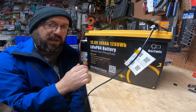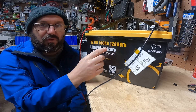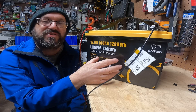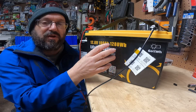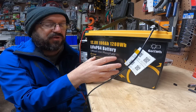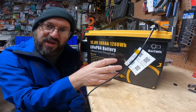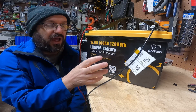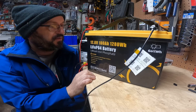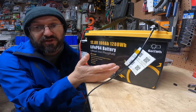And then I'm going to run it through a heavier load to see if it can hold a 100-amp load for a while and make sure that it hits the specs. And then I'm going to see how it does in an actual live off-grid system. I have a small setup with a couple of solar panels and a small load that runs continuously in a storm shelter. I'll drop it in there and test it over a couple of days. So we're going to do the scientific tests first, then a live setup. First thing, I'm going to charge it up. It comes at 50% state of charge, as they ship — I think that's pretty standard. The cells looked balanced, but at 50% you can't really tell.